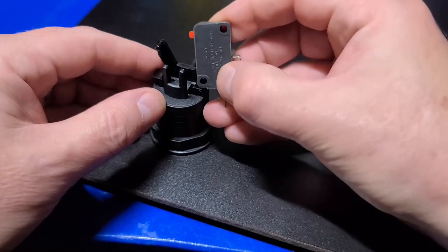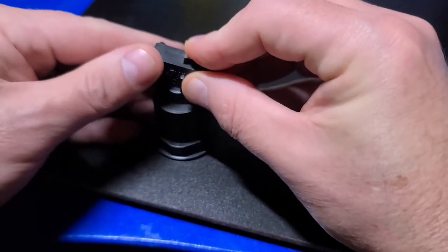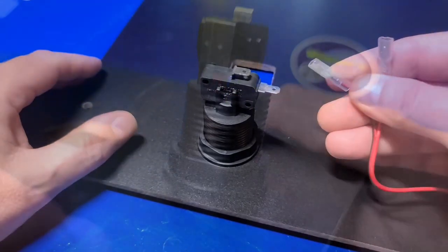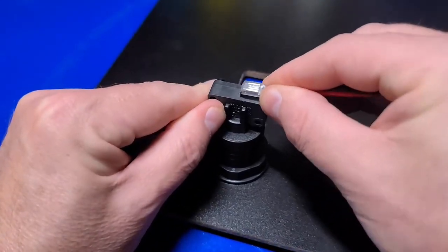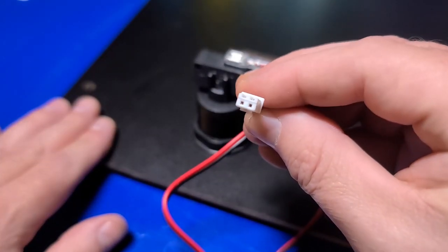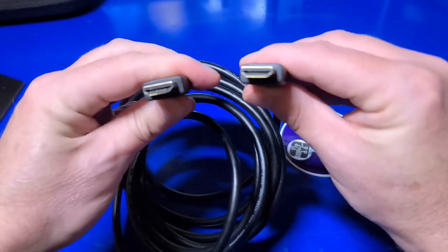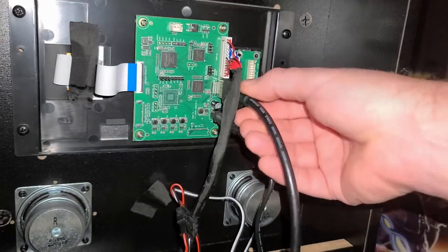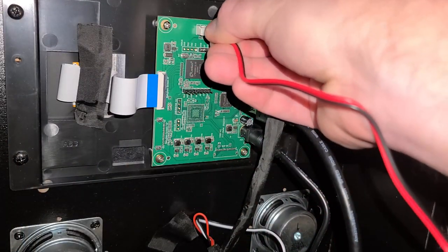Place the bottom of the micro switch into the peg at the bottom of the switch and gently do the same for the top, pushing it slightly to the right to lock it into place. You can do a quick check to make sure the button is pressing in properly to the micro switch. Next, attach the two terminals to the switch — it doesn't matter which wire goes where, just make sure they are fully inserted. The other end will connect to the VIBS board, and you will also want an HDMI cable at this point — the one here is about six feet in length. Plug in the power extension cable to the VIBS board and one end of the HDMI cable into the VIBS HDMI port. Then bring the back panel nearby and plug in the VIBS switch button to the small connector at the top of the VIBS board.